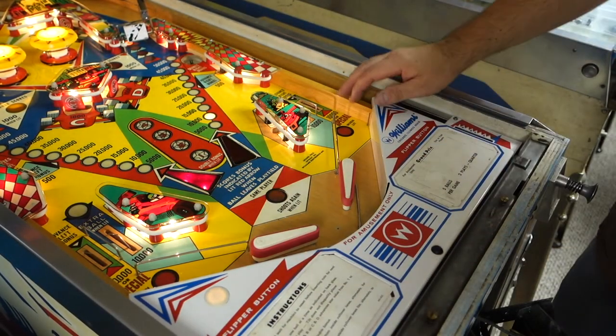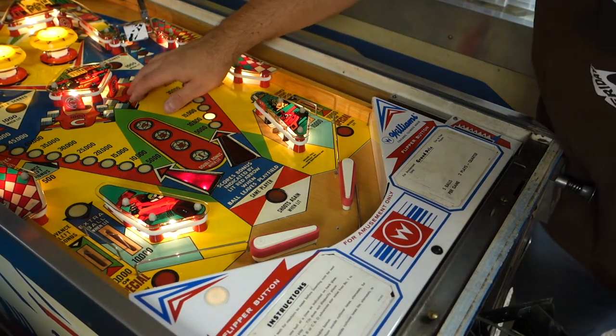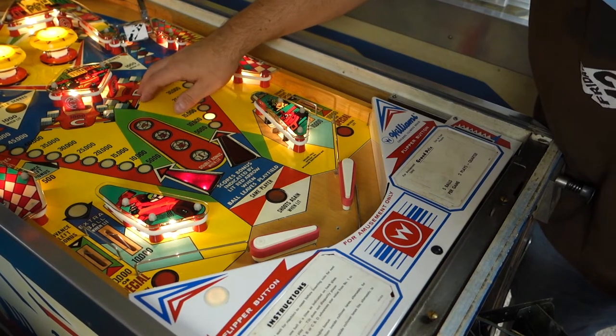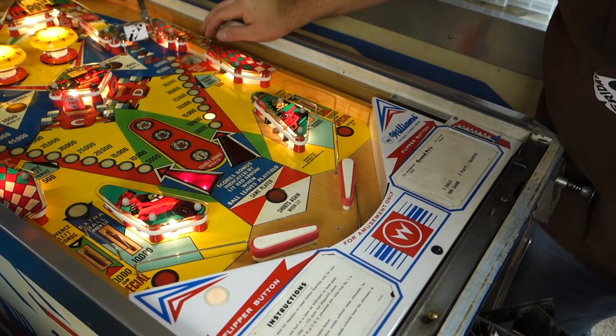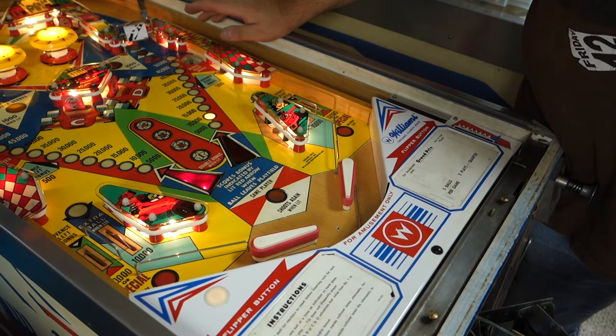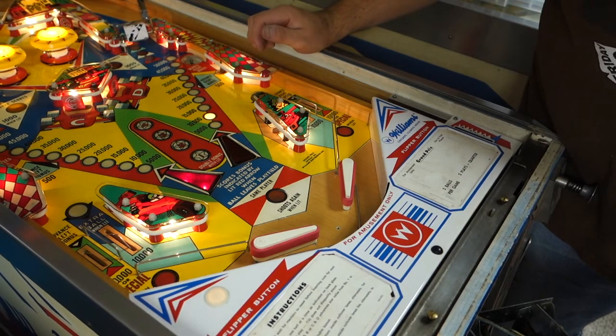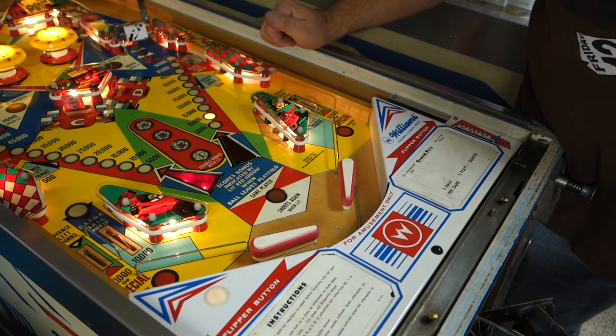That's it. I hope you enjoyed that video. As you can see, even though this game is done, it still needs a little tweaking. I'm guessing I gotta do something with these contacts up here. They're a little out of whack, and maybe up on the relays up there I gotta tweak the contacts a little bit. It seems if I hold them longer, they got a better zing to them. So I'll be tweaking those contacts before the final gameplay.